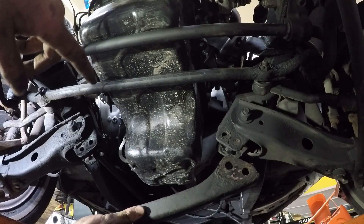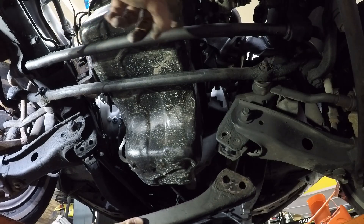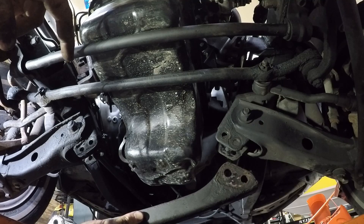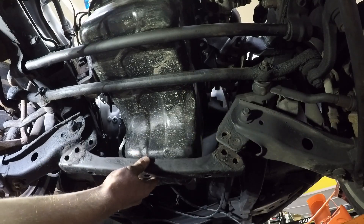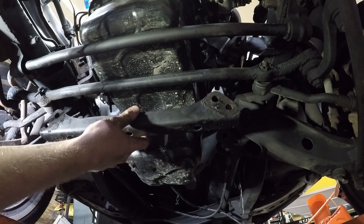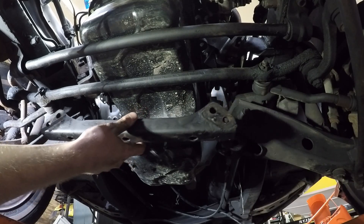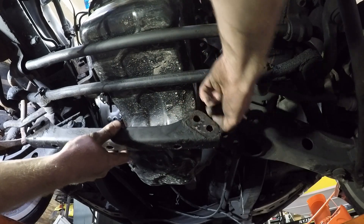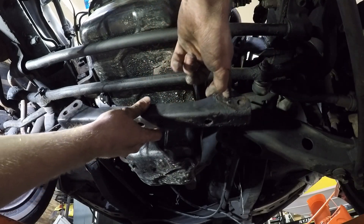As you can see, the motor mounts aren't quite gonna work. The oil pan is literally sitting on that, so it's just gonna have to be taller — no two ways about it. The other problem is this front crossmember right here. It looks like right around here is where things need to change, which means it's fabrication time because we're gonna need to make some form of adapter to go from right there to right here. Which is no big deal.